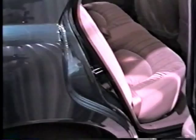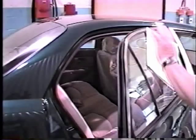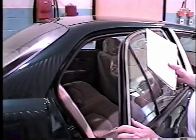Tom explained that adjustments on the rear door can be made by repositioning the lock striker. No hinge adjustments are necessary. If your striker's down too low, it'll bring the door down and keep it away from these two seals. This is a door-on process when they build this car. They build the side ring as one piece, and then they put the door in. There really isn't very much that you can do with a door here.